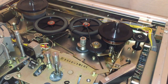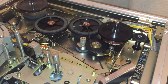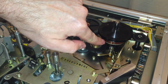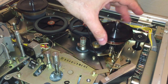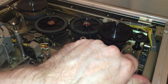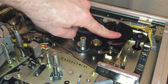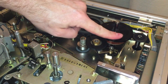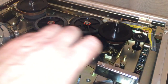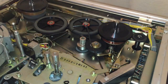So if I put it in playback mode, you can see the take-up spindle is taking up, attached to the black part on the bottom. I can grab hold of it and essentially stop it — it's riding on top of that foam underneath, which allows it to be taking up but not with so much force that it rips the tape in half. Now for fast forward, when I move it one more segment over, the pulley moves up a piece and attaches to the brown. There's plenty of torque going on there to pull a big heavy reel of tape. Let me demonstrate again: there's fast forward, and there's playback — and the idler wheel moves back down to the bottom position.